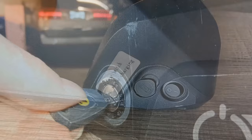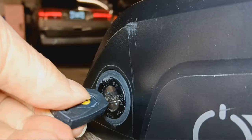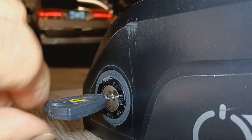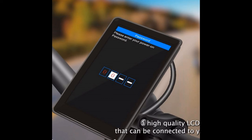Manufacturers have come up with two different strategies to overcome this. The low-tech method is to equip the battery with a three-position lock: off, lock, and power. When you turn the key from the off position, the first click locks the battery onto the frame — at that point there's no power to the system, so nobody can take your bike and use the motor for a quick getaway. To turn the power on, it takes a second click. On most e-bikes, once the battery is powered, you need to turn the system on with a button on the selector switch or on the display. The high-end solution is to require a password entered into the display to power the bike. With some high-end bikes, you can power them on through an app on your phone.